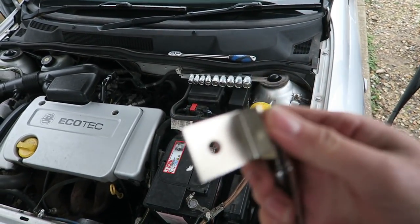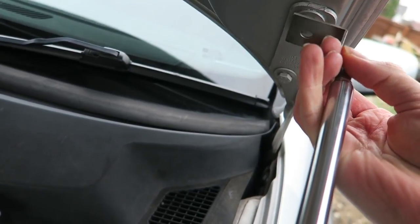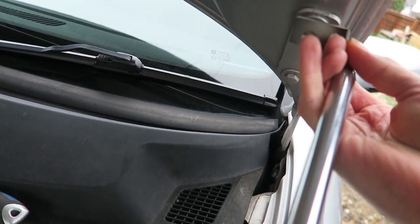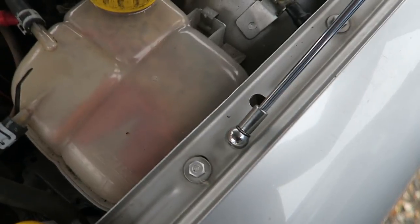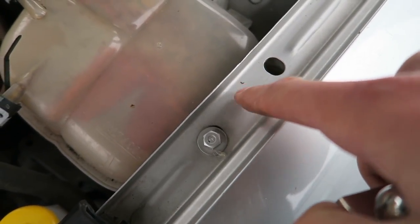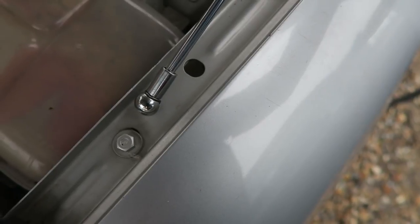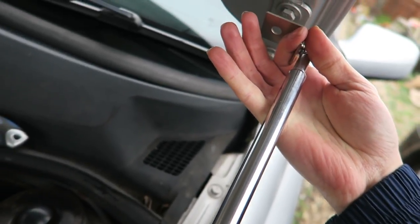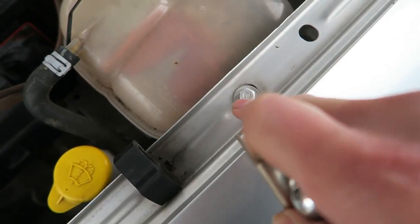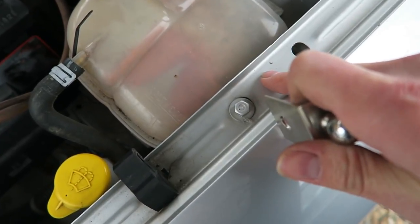I've got my strut and the mount, which I think is going to be mounting to the bonnet. I assume they want you to mount it to maybe this bolt here, or the lower one. I think if I take one of these bolts out that will mount to that and be the top end, then I just need to figure out the best place for the lower mount. From the picture it says to drill a new hole around about here, which would make sense because that's about where the strut finishes. I don't think the existing bolt holes are going to be usable — one's too far down, one's too far up — so I think I'll need to drill around about here.